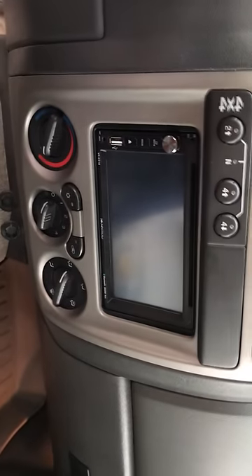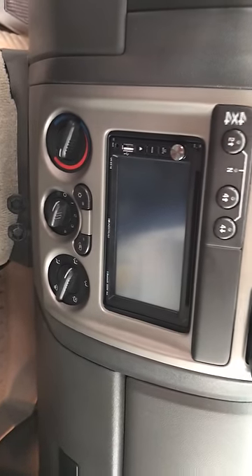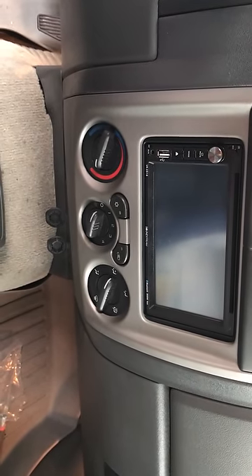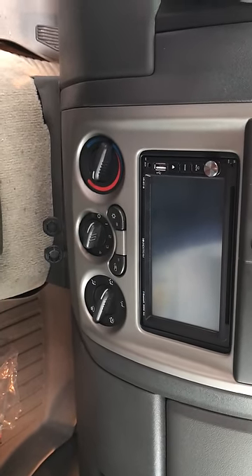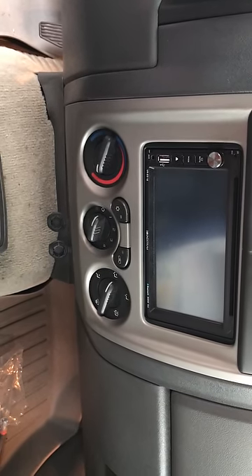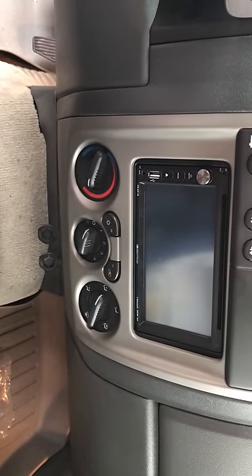One other thing to know about: if for some reason you don't get backlighting in the AC and heater section, the AC units in these trucks have LED bulbs that are put in series, and because of that, if one goes out they all go out — and they do fail quite a bit. You can order them, or I went to Radio Shack, bought some LEDs, soldered my own in, and that solved my problem. You can also go to a junkyard and get a replacement unit — I think locally it's about $21, and a friend of mine did that and his worked fine.